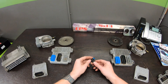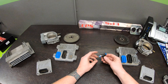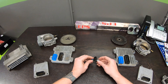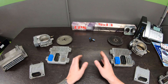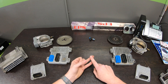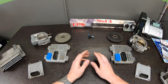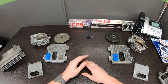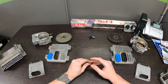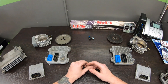All your other sensors are standard LS-based sensors. Fuel injectors are LS3-height EV6 connector regardless of generation — though that would really only matter if you're sticking with the stock LS4 intake manifold, which most of you probably won't be. If you're doing a swap, chances are you'll be putting an LS2, FAST, or Holley Hi-Ram intake on there. Engine coolant temperature, engine oil pressure sender — all the same as every other LS. Cam sensor is the same. Crank sensor is generation-appropriate: black crank sensor for early, gray crank sensor for later-model motors.